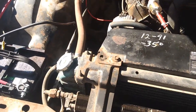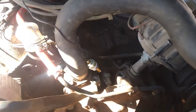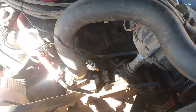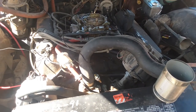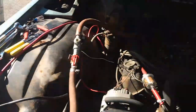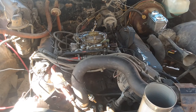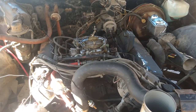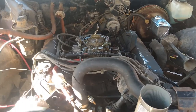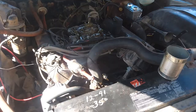When I check the radiator, it's up to the cap full of fluid, so when I take that sending unit out, it's going to gush coolant. So I think now's a good time to drop the stuff I'd poured in there to flush it out into that container and put in the good stuff while I'm doing the sending unit. Because I really don't want to mess that way, and the on and off driving I've been doing, it's enough to flush out the coolant at least, so I'm going to drop that out through the drain cock on the bottom.